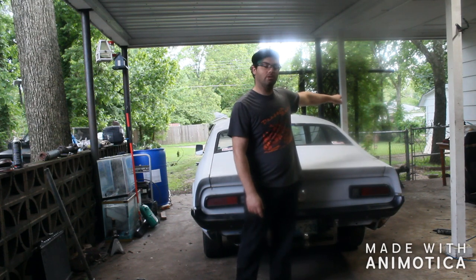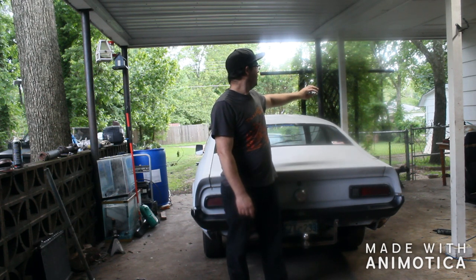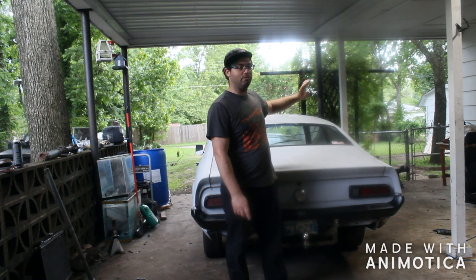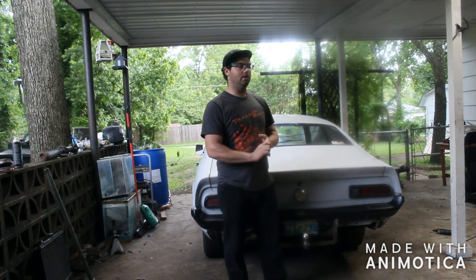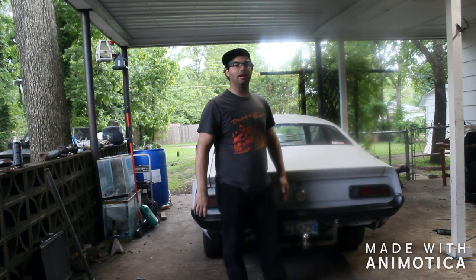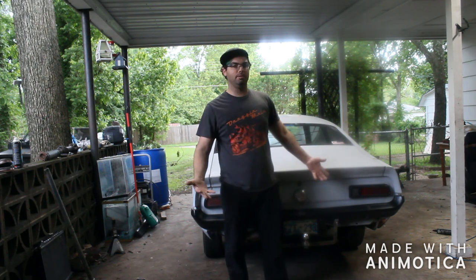I got some brakes for a Mustang that'll go on the 8.8. I've got to trim up the bracket that the brakes bolt up to. And they'll hook on there, and then get axles for it and get a rebuild kit for the front seal where the shaft goes into the third member. That's leaking, and possibly changing my bearings and we're going to be fine. So needless to say, let's start jacking this car up and at least get the first part of this humongous build done.